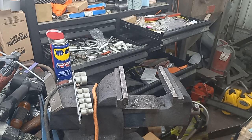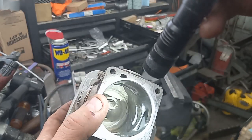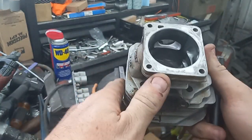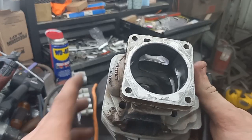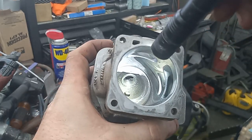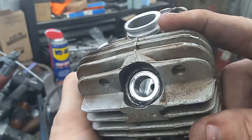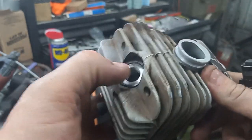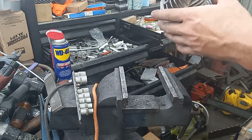Let's grab a flashlight and show you guys. It protrudes just a smidgen in, but it's below the seating surface, and I'm probably going to end up cutting the chamber on this anyway. Whatever's protruding will be addressed, but it's flush to the top. That shiny spot at the bottom is where one of the cutter teeth cut into the chamber a little bit — you can't control that. This is one severe heavy-duty thread repair. Because those threads are tapered, there's no way that insert can ever fall into the engine — it's wedged in there like a wedge.